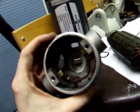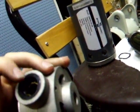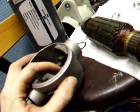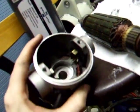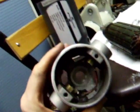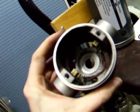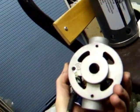Get it cleaned up, get the air line on it to blow all the muck out of it. Same for the head. There are little grub screws that hold in the brushes. That wire's got to be replaced, so I've got to peel it open, re-crimp that or solder it — actually, soldering wouldn't do; it has to be crimped. Cabling all needs to be replaced. And again with the Green Master, the earth wire comes from the inside of the motor out through the vent hole.